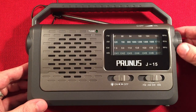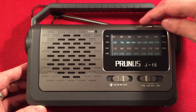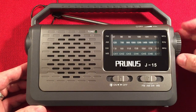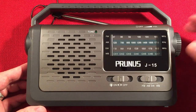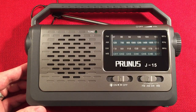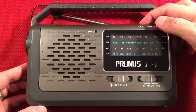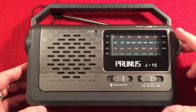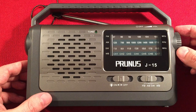So we're going to go to the FM band. I'm going to go fairly quick on that because we can't hover on music. Switch over to FM. Turn it on again. Here at the bottom. And you can kind of hear how the DSP tunes. It does it in little increments. You'll hear it click and stop. On regular analog radios, there are smooth transitions in between, while DSPs tend to lock on. But the nice thing about DSPs is once you lock on that station, it'll stay locked on for like days and weeks and never drift, which is fantastic.